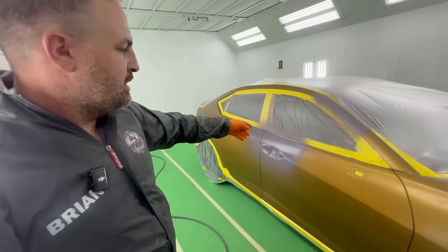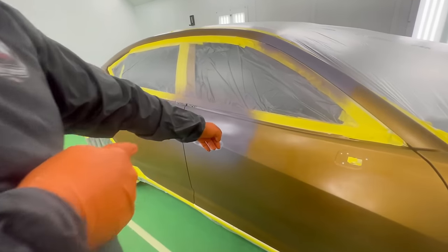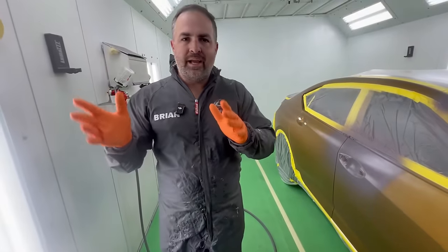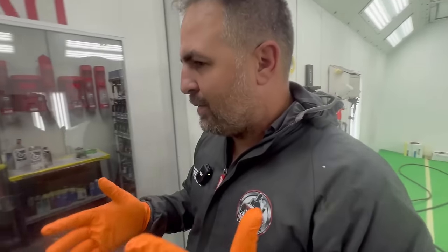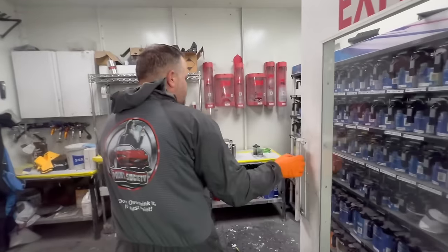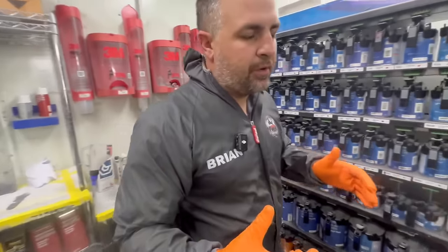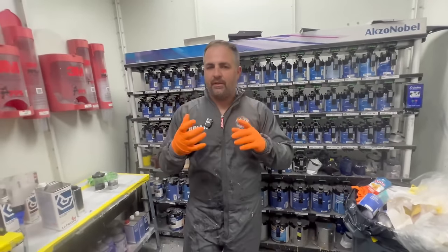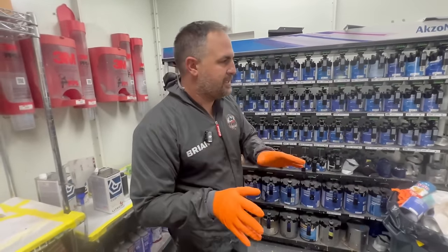Now, you notice the sealer has a little bit of red in it, right? Okay, that's going to help with our color. You cannot just go and take red toner, follow me, or red paint and put it in your sealer. If you do that, you're going to reduce the solvents and everything that makes up that sealer, or sealer adhesion, everything, you're gonna mess it up.